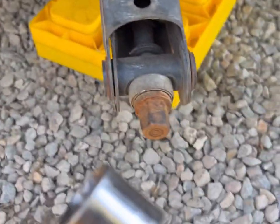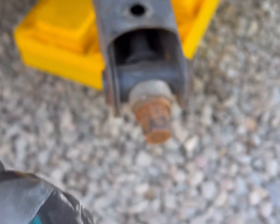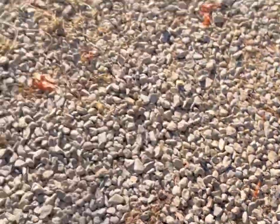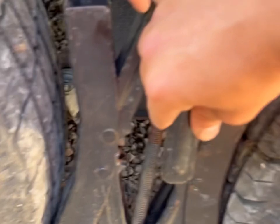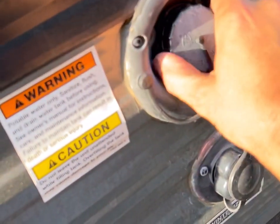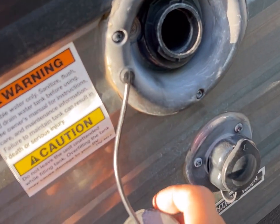There are level wheel chocks and stabilizer jacks to bring down the stabilizers on all four sides. You can also use an impact drill with a three-quarter socket — it's quicker and speeds up the process on all four sides. These are stabilizer jacks that go in between the tires on each side, and that is the ratchet you use to tighten it against the tires. All these accessories are found in the storage compartment in the front of the trailer. If you are dry camping, this is where you would fill up the fresh water tank — it stores 30 gallons of fresh water.